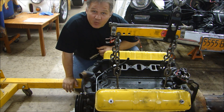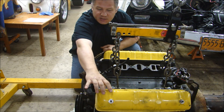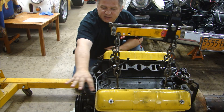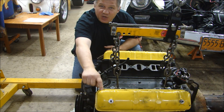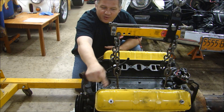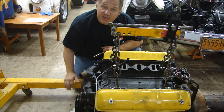If you're ever wondering how to find the number one cylinder on your engine, if you look at it from the side and straight down, you can see that this cylinder head is slightly ahead. That's because the connecting rod for this cylinder is in front. So number one cylinder is always the one that's further ahead. So it'll be 1, 3, 5, 7, 2, 4, 6, 8 — though depending on the brand, it could be numbered 1, 2, 3, 4, 5, 6, 7, 8.